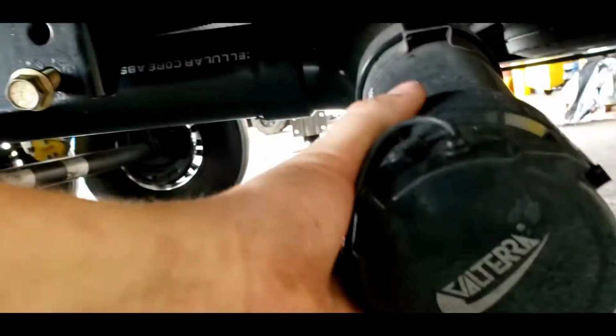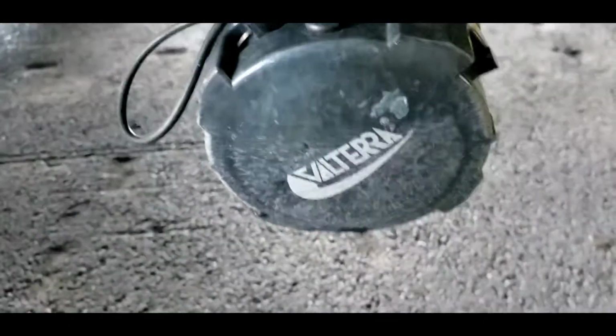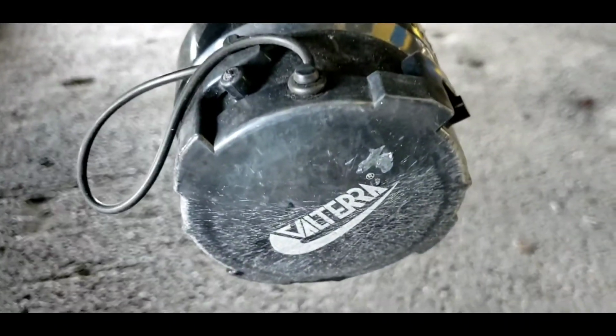Right here, gray tank for the rear of the unit. You look underneath here. This is where you can hook up your hose to dump everything. All your handles for it are going to be in a different location, unless they're tucked up underneath here. Yep, right there is the handle for it. So just push it in. That is closed. Push it in to close, pull to open.